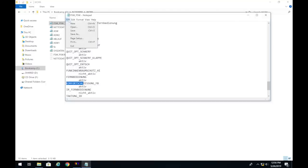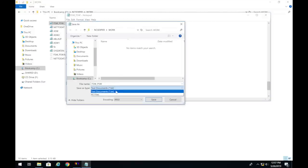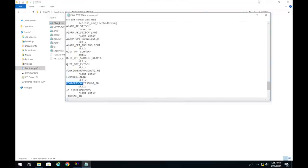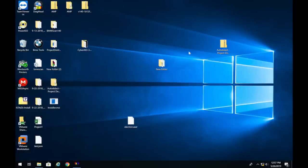If you found any of those three parameters in GM5, right-click the file, click Save As, change the file type to All Files, and rename it from FSW_PSW to FSW_PSW.MAN. Click Save — it will say the file already exists, click Yes. You should now see a new MAN file with today's date at the top.